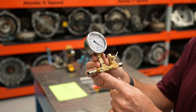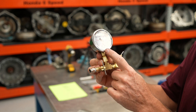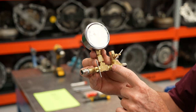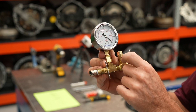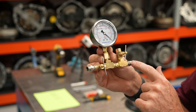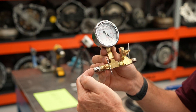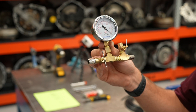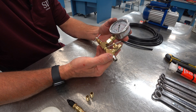Here's the finished product. I've got my push fitting going into this needle valve, through this brass T, up to the vacuum gauge. Through an eighth-inch nipple to another T, up to this needle valve that's going to be an air bleed, and then into this push fitting that goes out to the work. So this is the vacuum pump coming in, and this goes out to my valve body test plate. That's about $60 worth of stuff right there.